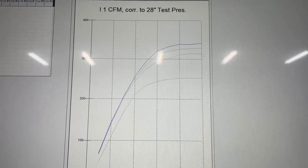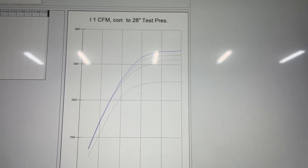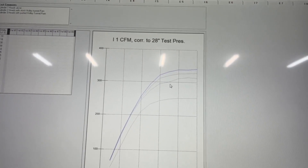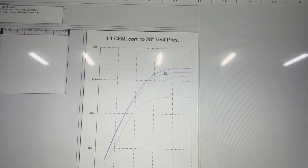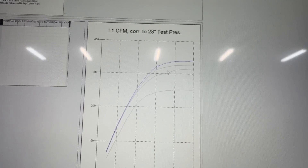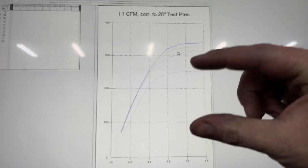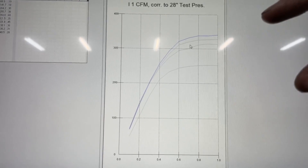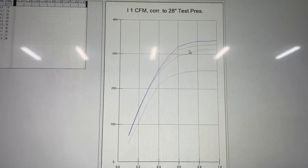This is graphs, so I can show you this way first and then I'll show you the raw numbers. You see this blue line here — this is intake flow. This blue line is the head itself just flowing it as is. This one right here is the ported intake and this is the stock intake. You can tell the ported intake is way better than the not-ported intake, but it's still not matching what the head flows alone. A tunnel ram should have flowed close to the same — it can, unless it's a different design. This one, the runners don't exactly align right. You've got a port opening like this but the intake is pointing like this — the intake is coming in one way and then going another. So even though it's kind of a straight shot, better than a single plane, it's still not perfect.